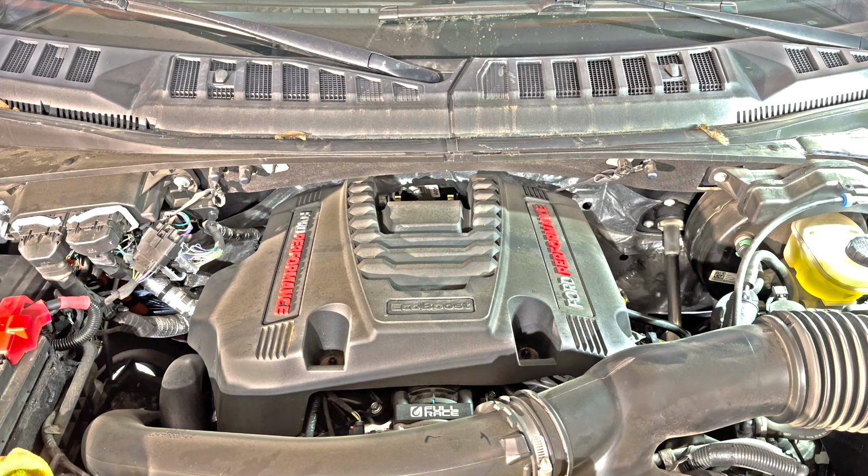So I'll show the spark plugs here, the difference between the old ones and the new ones. The NGK have a different design, so we'll see how they work. I will note that I didn't have any additional performance gain or anything like that from the one-step colder plugs that I could note. I'm sure they're better for tuned vehicles, but if I'm not having any problems with the engine, I'm happy. So hopefully I don't have any issues with the NGK plugs.